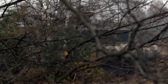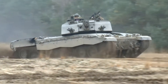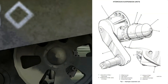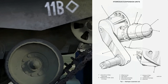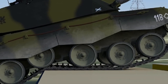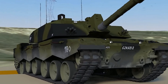If this vehicle were given poor suspension, the gun would not be tracking as beautifully as it is right now. All six stations of this vehicle utilize the hydropneumatic or hydrogas suspension system, and they are all tuned to different gas settings. Hydrogas is pretty much exactly what it says — it's liquid versus gas. In each bottle attached to the hydrogas system, it is trying to fight against those road wheels pushing up when crossing rough terrain. Station 1 and 2 take the majority of pressure inside that bottle. When the liquid and the air push against one another, it makes a nice solid cushion for the tank. The rear station at number 6 is also quite highly pressured in case the vehicle goes into reverse.